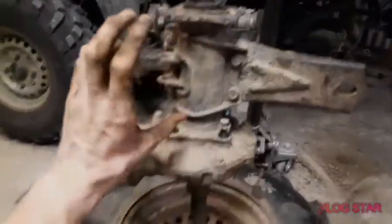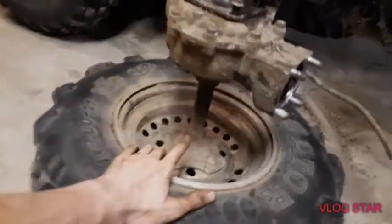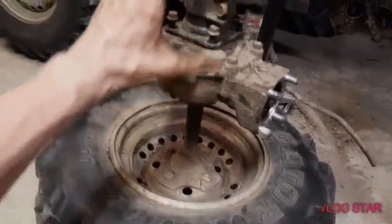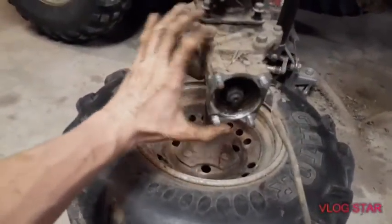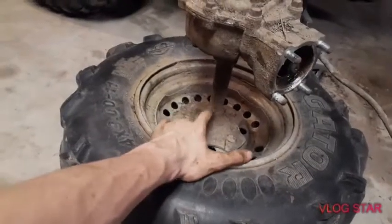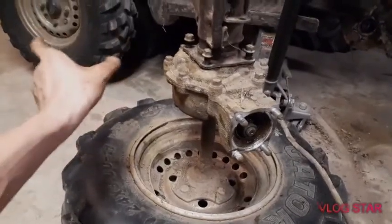I took a closer look and just took this middle section off — just these four bolts, which I'll go more in depth on in the next part. Come to find out, we are going to have to grind off this side of the hub and undo these axle nuts as well. When you do this side, this part comes off, and this tube can go with either side. The actual diff with the pinion and the ring go on this side, so in the next video we'll take care of that and then do all the bearings. After that we'll also do the front bearings on the four-wheeler.